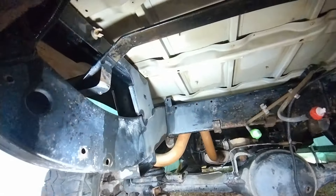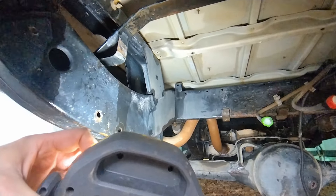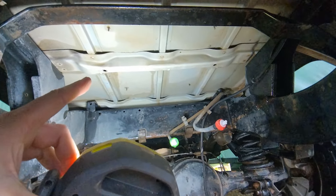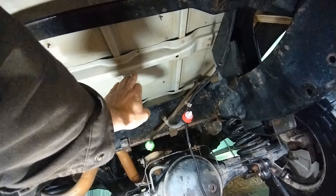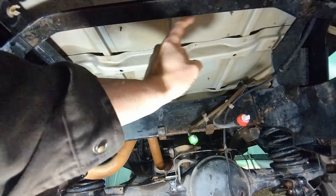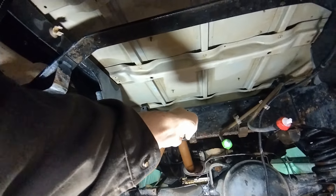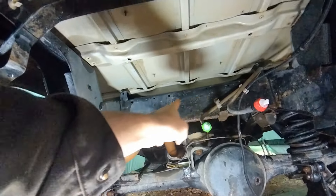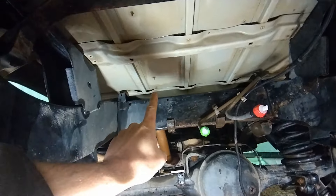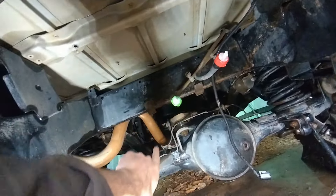This has been cleaned out — all the mud is out now, I think. I've got to wipe it down and get the mud off before I can treat it; I've got some Bilt Hamber spray to go on. Those sections at the top took a bloody long time because that's where water collects on the inside. I'm sticking a wire in to check if it comes out muddy. There are four of them along there — one of them is quite tricky because you can't spray up from underneath due to cross members in the way. The one after that has the seat belt mount blocking the drain hole, so there was a lot of mud in that one.